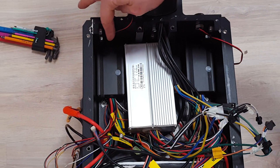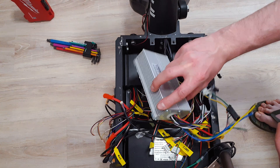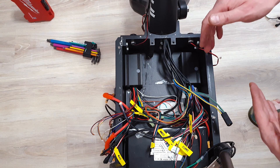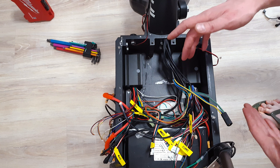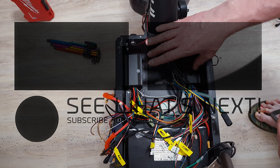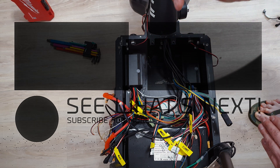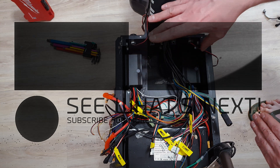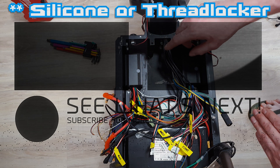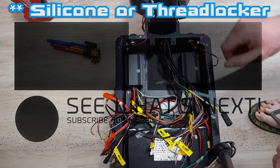This is just one stock 45-amp controller. It's like 4 times bigger compared to one of these small FlipSky units, and about 10 times heavier — so this is really a waste of space. As you saw, it was a pretty easy mod. I do recommend it if you'd like to install more powerful controllers and be sure they will not overheat. If you have any other ideas how to install controllers, please share in the comment section. And no worries if you have to drill 4 or 8 holes to secure the controllers — the frame will not break. Just don't forget to add silicone on the screws to prevent water from getting inside. See you in the next one, bros.